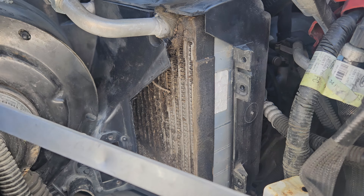Other people look at this and say it needs an evaporator; some people will throw in a heater core also. It has no leaks — it just has restricted airflow. We do this job, make some good money doing it, but we didn't have to disassemble the whole car. Anyway, this is Kevin, House Call Auto Mechanics.